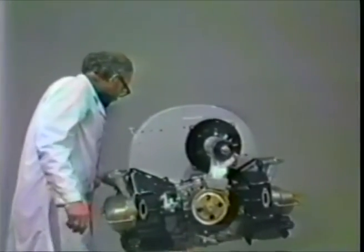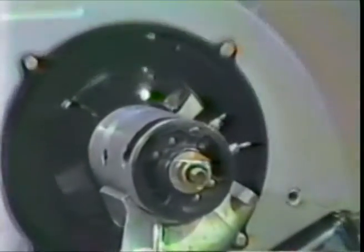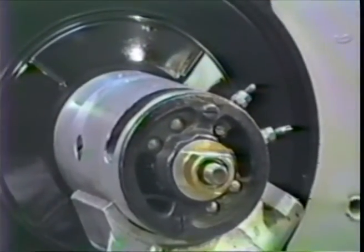Also, the dipstick shroud goes on top of the cylinder shroud. I've seen many engines where the dipstick shroud went underneath the cylinder shroud. Now obviously they've been overhauled. Okay, thing to do now, we'll put the nuts and bolts on in the proper way. The 6mm bolts, of course, go on the vertical surfaces, and that's what we'll put in.